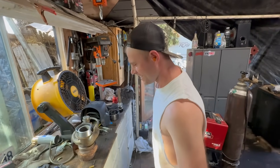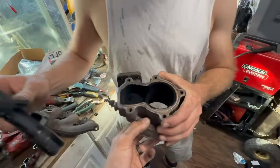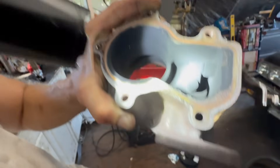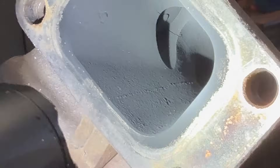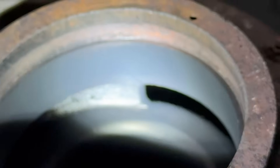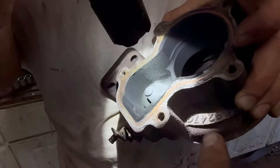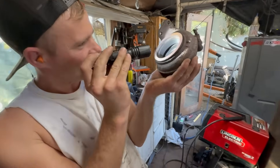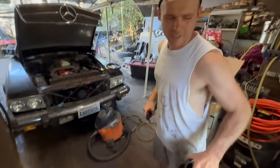The HY35 already has a crack right here - this is how Daniel got scammed. He bought this turbo and it came with a bunch of cracks. That crack goes all the way through, and there's another crack there too. On the inside, the crack continues up the wall. Dennis is going to weld it back up - set the welder to maximum, slower speed, let it become lava, and hope it holds for a few runs.